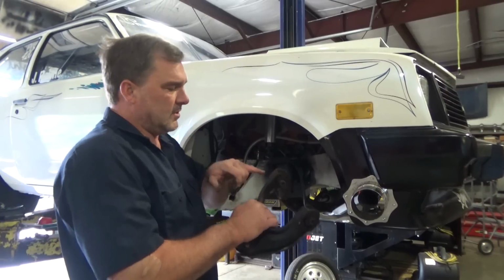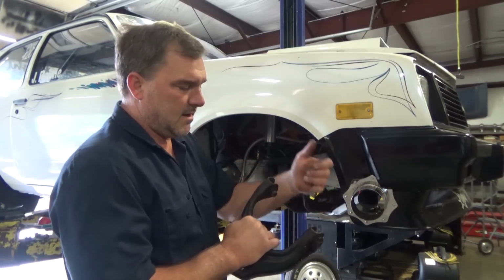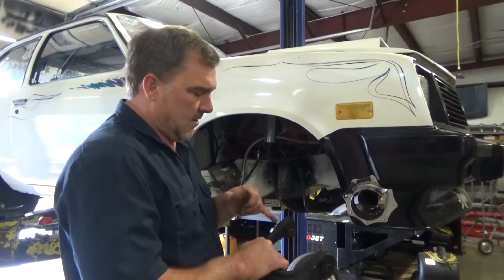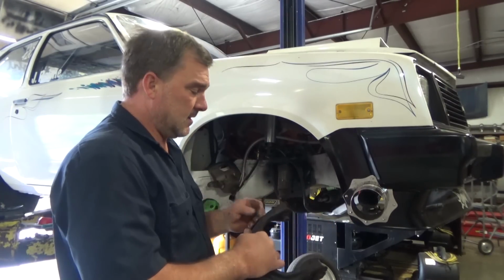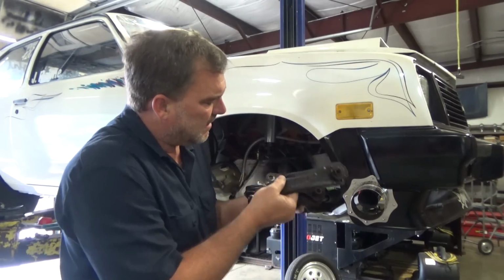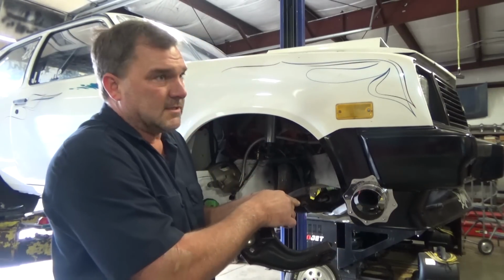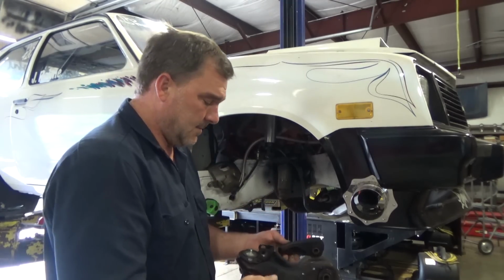Oh, it was trying to pull that bushing. It was trying to pull that inner liner out with it, so it was seized to the liner there and there. I don't know if heating it up through here, it probably heated the bolt so that it helped release it there and there. But these have the slots in them. So if we can find the slots and hit them like I did the other ones to spread them, that might help the other side come apart a little easier.